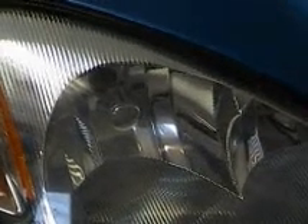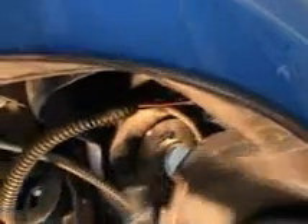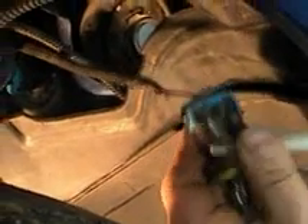Now on to our low beam bulb. Grab it on the back of the bulb, turn counter-clockwise and wiggle out. Let's have a look at our low beam bulb. This bulb is a 9006X-S. Let's go ahead and remove that — same as our high beam on the back side. Support the clip back and pull. This bulb is also good, so let's go ahead and reinstall. Put it back into place, and remember to clean the bulb off so no grease or oil gets on it from your fingers.